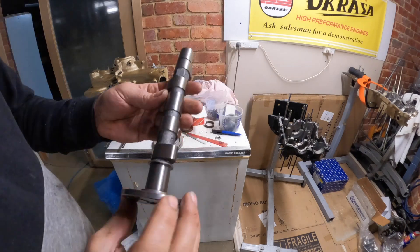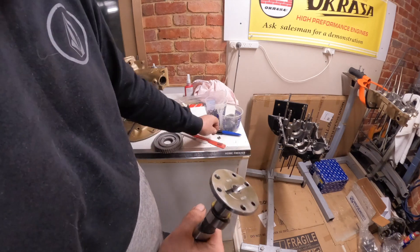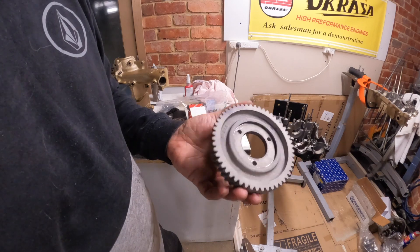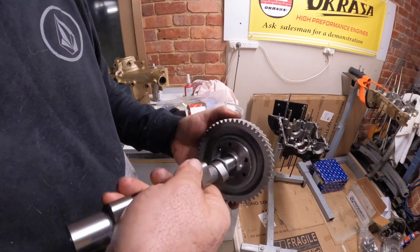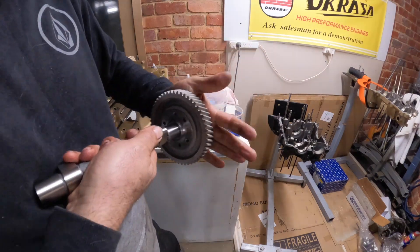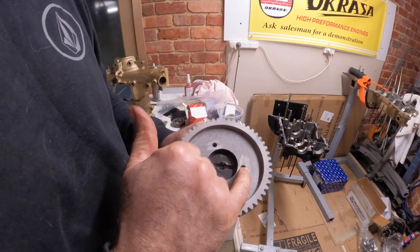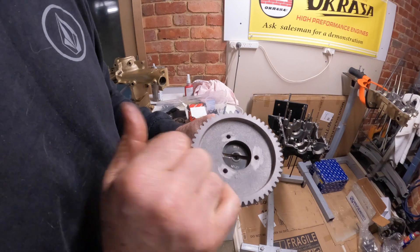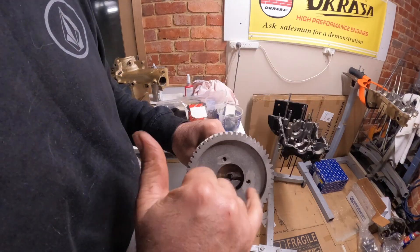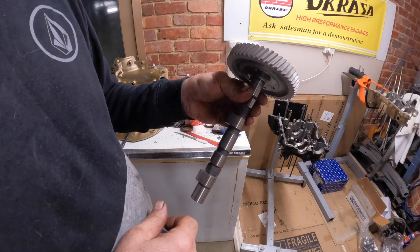This is our 356 cam and we've had to take out the dowels because we're not going to use those - well maybe we will, we'll see. That's the original 36 horse gear and we can pop that together, get our holes lined up and bolt it. We'll get our bolts worked out - you can step these down or grind the head of your bolt, but we won't know until we pop it in the case to see how much clearance we've got from the oil pump.